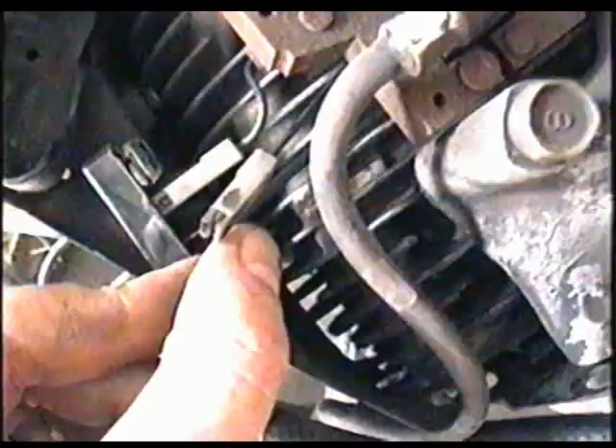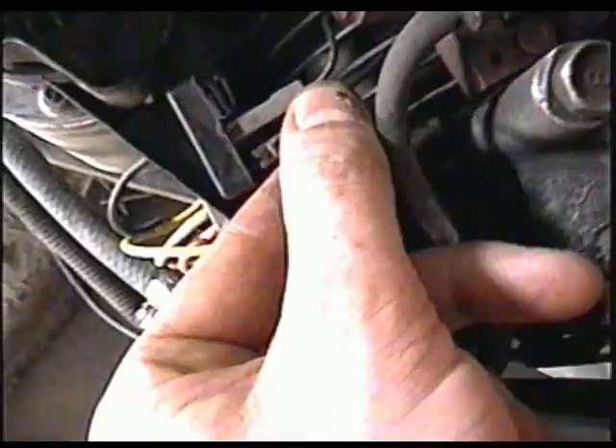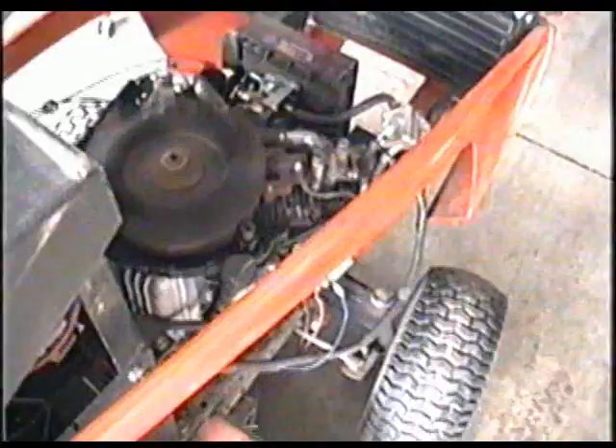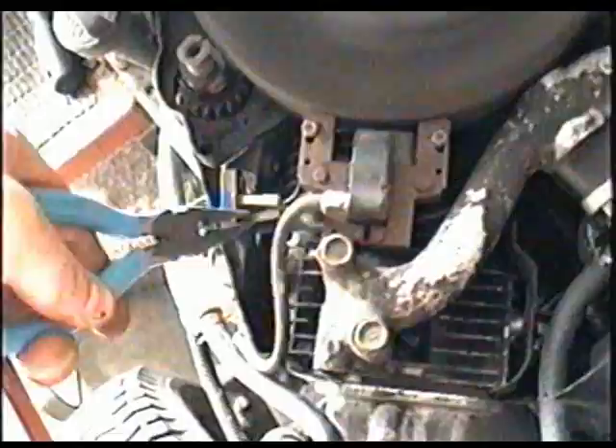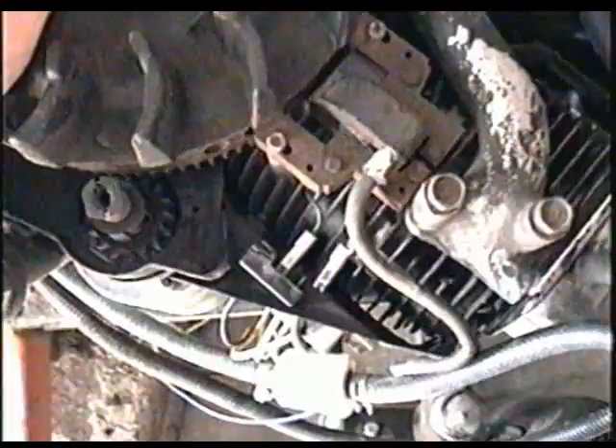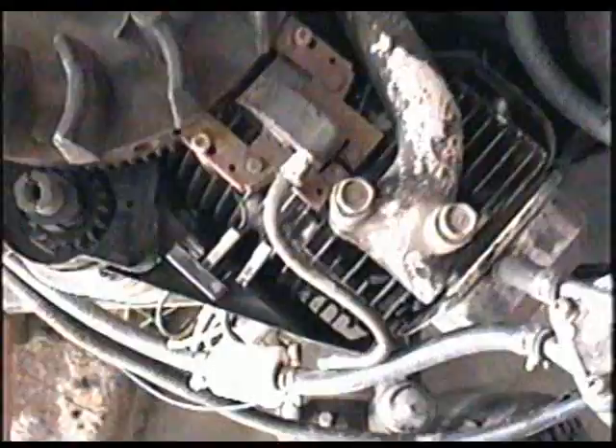I realized when I took it apart that somebody had disconnected this wire here. But if you connect it back, it will just run on one cylinder — and I'll show you that. So probably what they did is they disconnected it and just kept it like that. You can hear it turning on one cylinder. So if you have a problem with this diode, it could happen that your motor is going to run on one cylinder, or it may be hard to turn off like it is for me. I'm 100% sure that that's the problem.